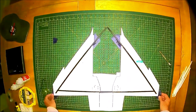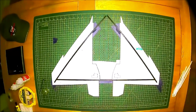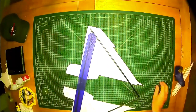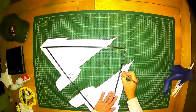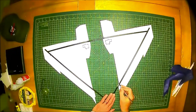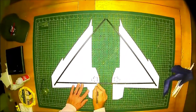Start applying the epoxy to the wing plate where your carbon rods will go — be as careful as possible but make sure you've got a good amount of glue into the spaces. Leave the space in the centre where the EDF unit is due to go, then tease out the glue to the end of the surfaces. A quick tidy up with a scrap piece of foam, add some additional epoxy to the top where there are gaps, spread it across the carbon spar, then remove any excess glue. Finish off with the batteries to make sure it's nice and flush and leave it to cure — this is 20 minute epoxy.